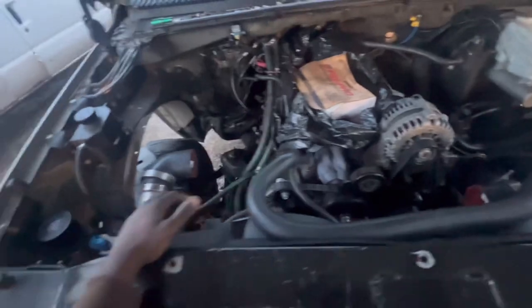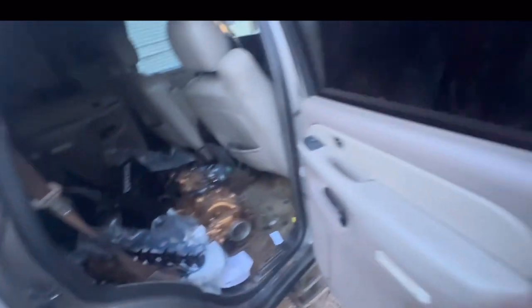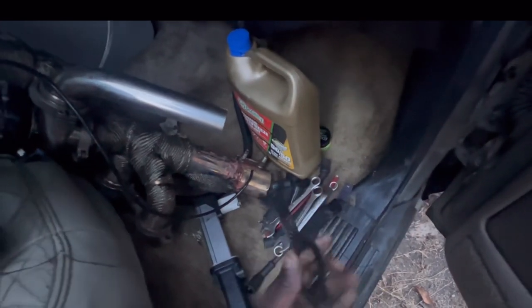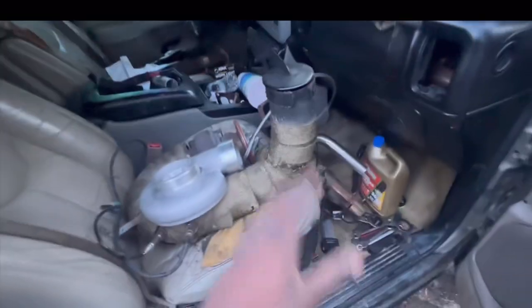Once that's done I might throw the outside back on with my new gasket. As you can see I got it messy in this truck, but anyway — new gasket. I'm running the original style. The one I had was like metal and they got shot up, so I'm going with this one. My tuner recommended the original style. The shot-up one is right here — that's causing my exhaust leak. The bolt had broke on the other head, so anyway, it's gone.